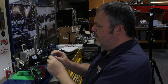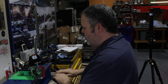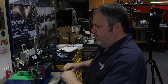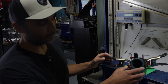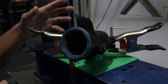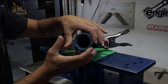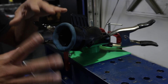So what I'm going to do here is just put a little clay around the outside edge to see if the air likes a nice smooth transition — just think about it, everything likes smooth transitions. If you want to hit something hard, nobody likes that. So we're going to put a smooth transition around it and see if that changes anything. What Dave's doing here is he's created this little velocity stack tulip shape on the top of it, and what that's doing is converting the flow that enters this tube from turbulent to laminar. That's important because in the real world this tube is connected to another tube that's connected to the air filter, and the air isn't coming from around into the tube — it's a nice smooth laminar flow into the elbow. By doing this we're going to at least simulate that a little bit more and really gauge what this thing is doing. So without the tulip we're at 214 CFM — with the tulip, let's see where it stacks up.